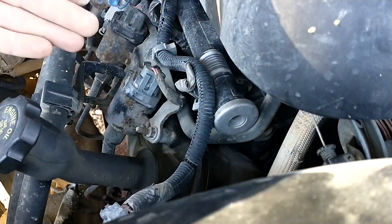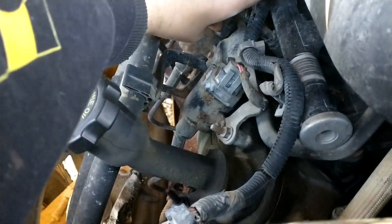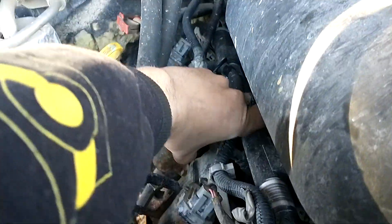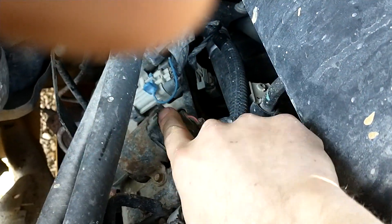So at this point — see that? That cylinder is working. Right off the bat, I'm going to say this one is a different color than the others. This might be the culprit. You see that? No change. Watch. No change. That is the culprit right there.